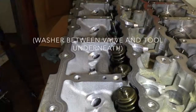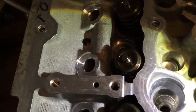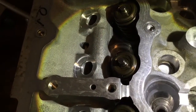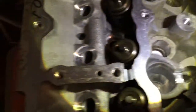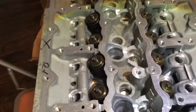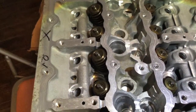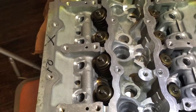I want to draw your attention to something: if you look at the exhaust side valve, the way it stands out from the clips over the washer, and compare it to the intake side, you can see it's not exactly the same. That's quite an important detail - when fitting them you want to make sure they're at the right place when you release them. One useful tip: try the clips on the valve while holding it in your hands without the spring. That will help you understand what it should look like once it's in place.